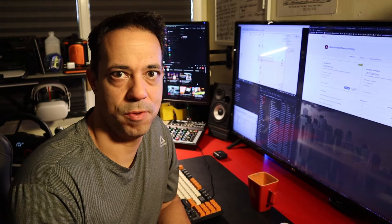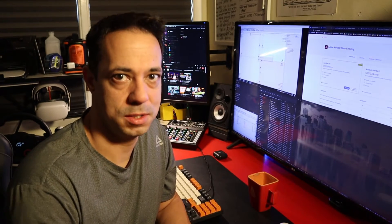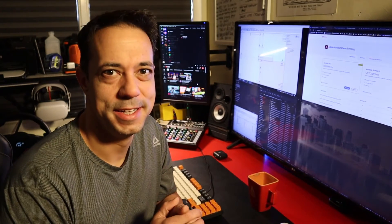Hey everyone, I just wanted to make a quick video. It's regarding a video that Linus Tech Tips put out last week. They really documented well the problems with Windows Modern Standby, particularly the battery drain issue where you would close your laptop up, think it went to sleep, and then later on or the next day open up your laptop and find the battery's dead and the laptop's hot. Linus Tech Tips recommended a possible solution where you make sure that the laptop is unplugged before closing the lid to make sure that it goes into the proper mode of Modern Standby so that it doesn't keep the wireless communications up and running. That may work.